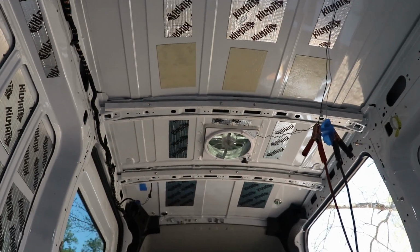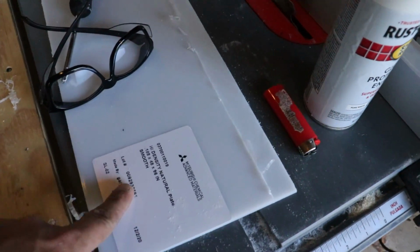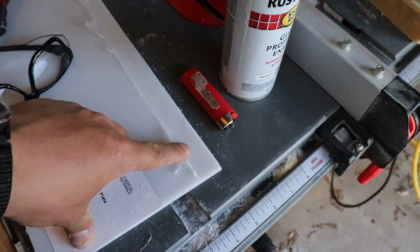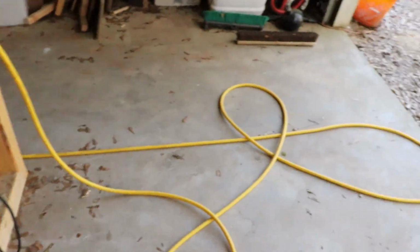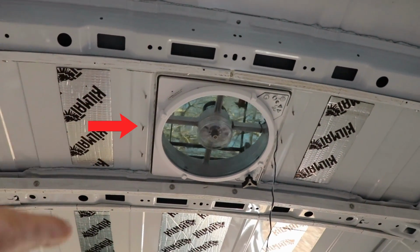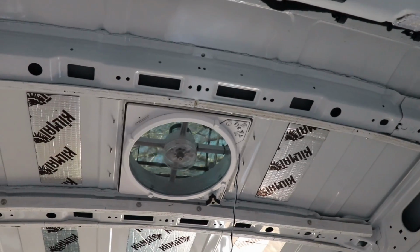So one tip, I guess, if you're doing one, you make your template a little bit small. This piece of HDPE is basically 5 gallon bucket material. Cut it down, you can see, trimmed it down. It's actually 3/16, but you need an eighth. And that goes in each of those peaks in the little valley there for that runner. And it made it level for screwing in the frame to mount the MAXXAIR fan.